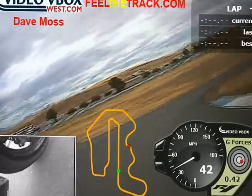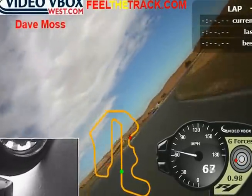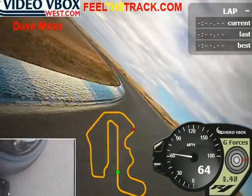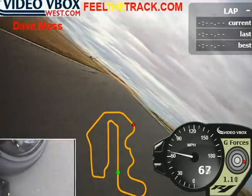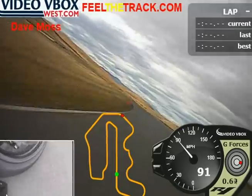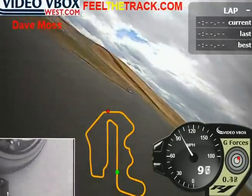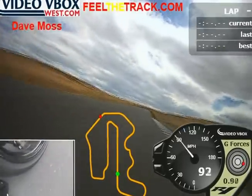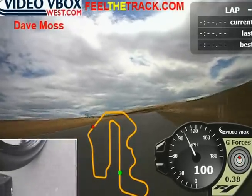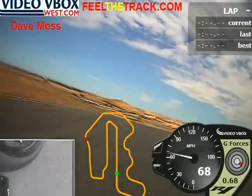You'd expect it, once it gets on its side, to be there — and that's a real subjective word. But you feel like the tire sets in on the side with a V-front. That's the conjecture. So the thing I'm concerned about initially on my first lap of feel is how quickly do I turn the bike, and how much further do I have to move my turning point, because it's got a lot more initial flick onto the side of the tire.